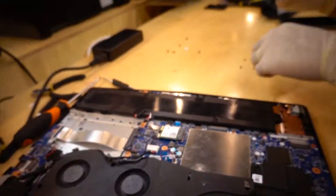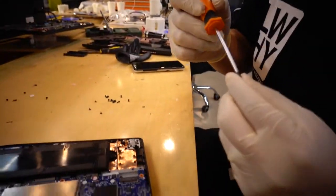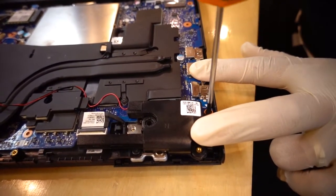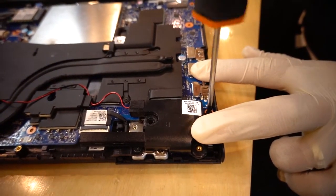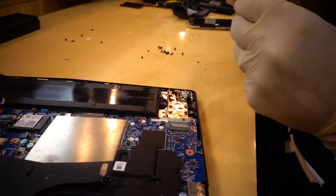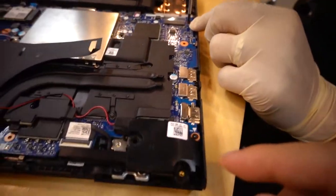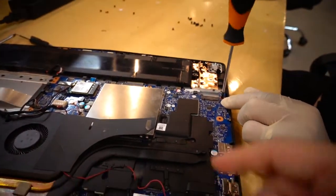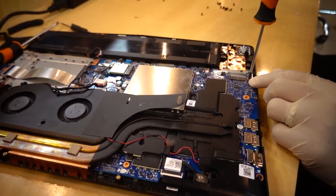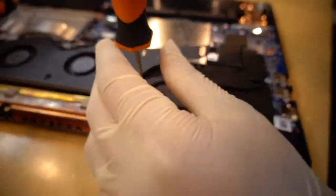The cover has an arrow marker — check that alignment. Put it down and connect to the motherboard. There are two screw points here. Check with the white circle points — only the white circle points connect the case to the motherboard. For the best method, use the X pattern: first left, then right.